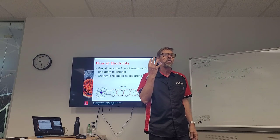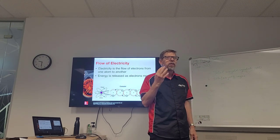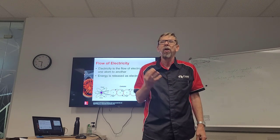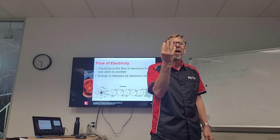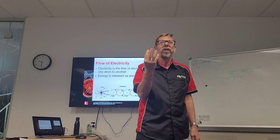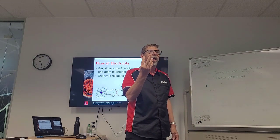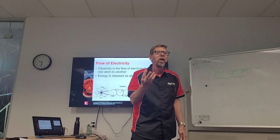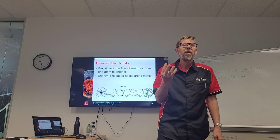Those four things I want you to memorize and keep in your mind, so that when you are working on electrical things, you know you're only looking for one of those four things. And it's very easy to work out which of those four things very quickly. When you have a blown fuse, that would indicate you've got a short circuit. If you have no power going to the load, that means you've got an open circuit. You'd have a dull light, for example, which means you've got resistance.